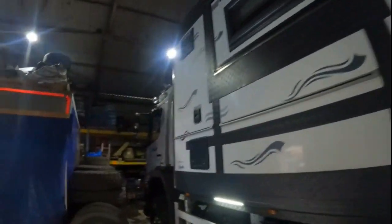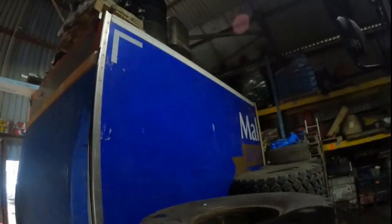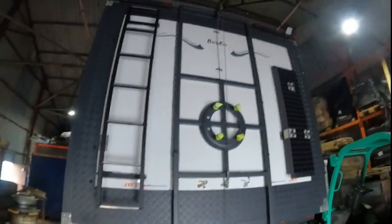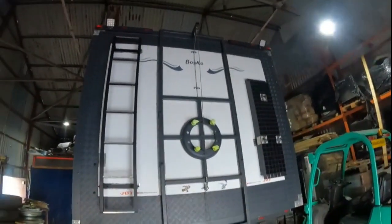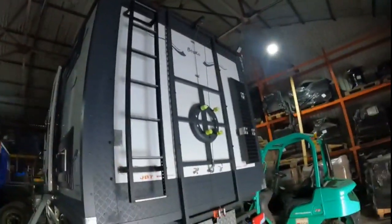This is actually the donor box that we used — what's left of it. We cut 17 and a half feet and then chopped 18 inches off the height, basically supported it all, glued it all back together and sealed it. Going on to the back, we obviously had to build a completely new back end on it. That's all reinforced inside with a 40mm box section, crisscrossed. We're only 6mm out, which I think is quite an achievement for doing it in a garage.